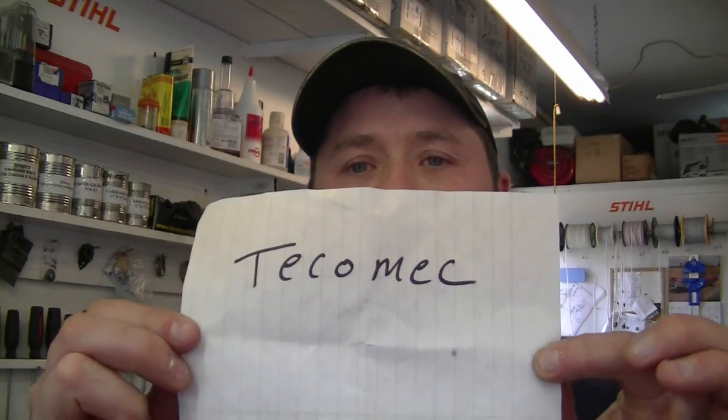Tecomec is the aftermarket brand I recommend most. Another question: a YouTuber who rebuilt his two-cycle scooter engine asked if it's okay to add four-cycle engine oil to the fuel just for the break-in period. Probably not harmful, but the manufacturer would recommend two-cycle engine oil in the gas for a two-cycle engine's break-in. Personally I would use two-cycle oil, but I don't see a big problem with four-cycle oil. Feel free to share your experience in the comments.